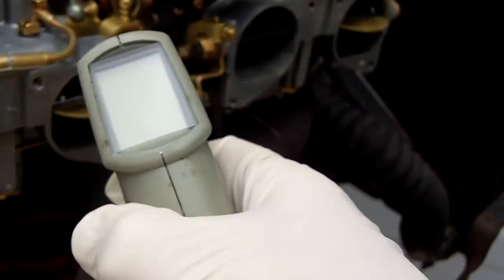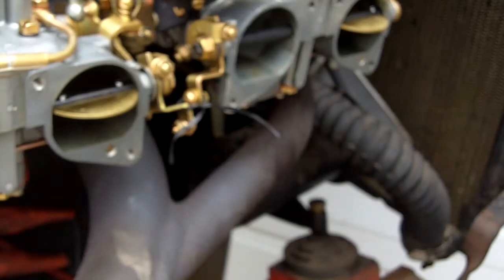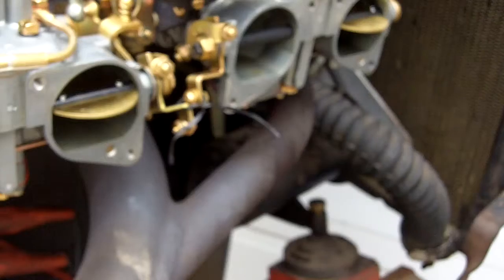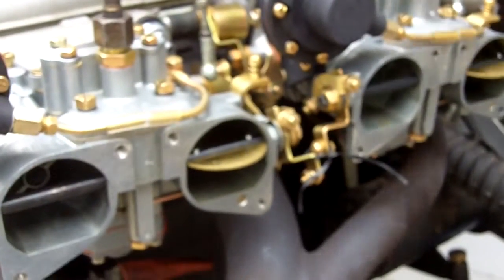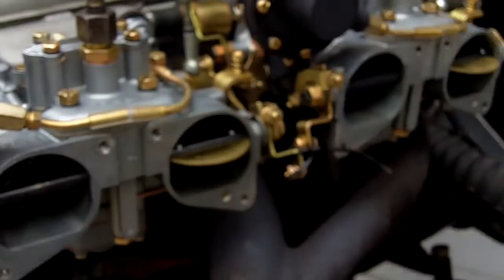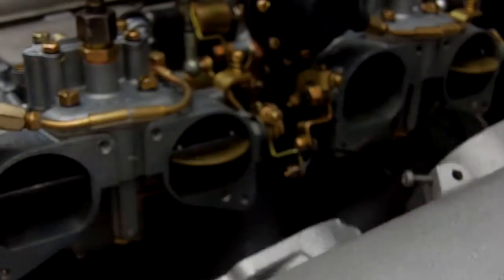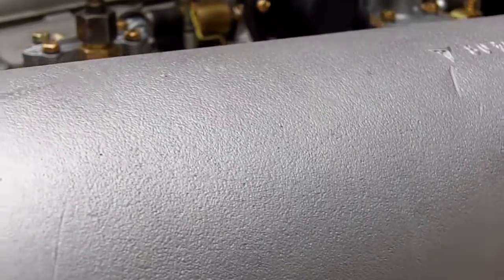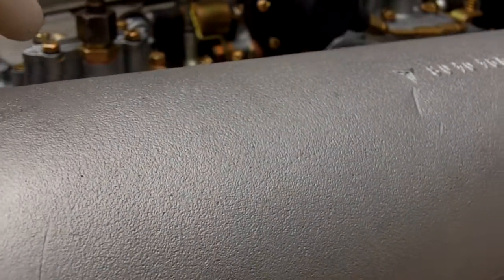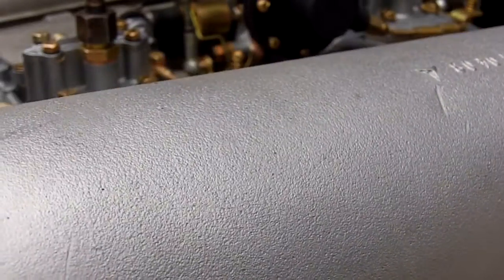This is an actual cold test — 42 degrees out here, so these are definitely cold-soaked carburetors. Let's go over some mounting first. You're going to mount these carburetors loosely so they can slip up and down a little bit. The reason for that is you want to put your air log in place and move the carburetors around so the air log will line up. The air log slips in place, and at that point you attach your air log with two to four screws or nuts on each carburetor so that the air log is attached to the carbs and the carbs are in line with the air log.